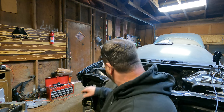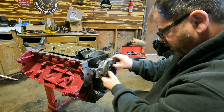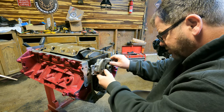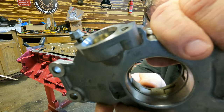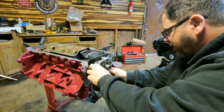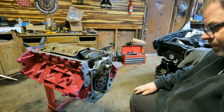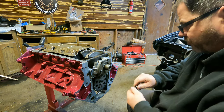So I've got the oil pump right here. Try and finagle it in there, which again is probably easier said than done. This thing moves in there. You gotta make sure it's centered. And then there's these little teeth. Winning! Just like so. We have our four bolts here.